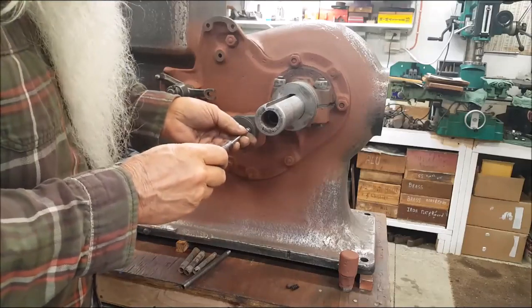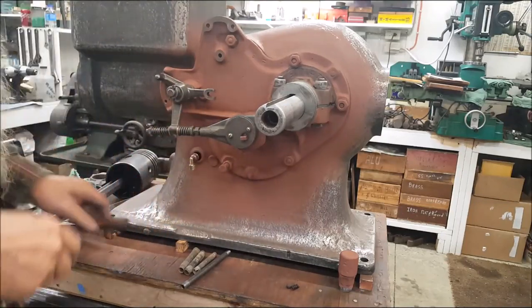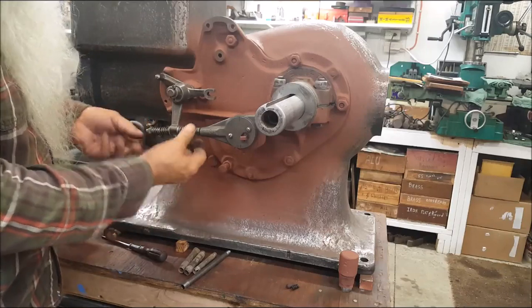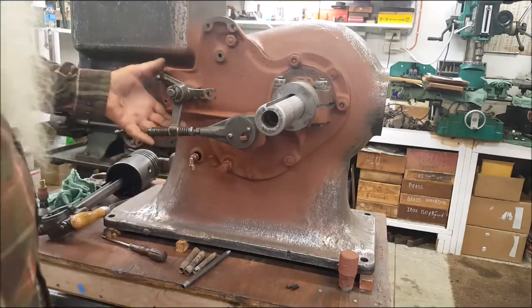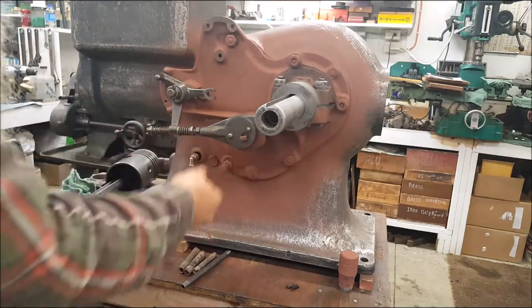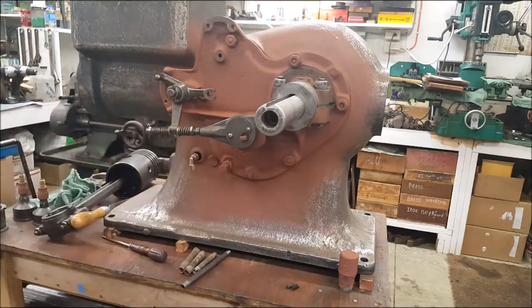I think they call them stove bolts right there — got a little lock washer on the back of it. That'll go on there like that. Like I say, we'll make adjustment here on this whole mechanism as to when we want it to trip the EK mag — we'll do that later. This came on the engine right there; actually I put a better one on there, but the original one would have run on it, so I'm not going to add any cost on it.